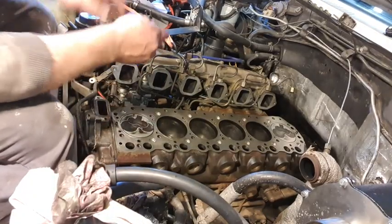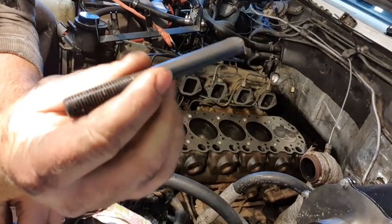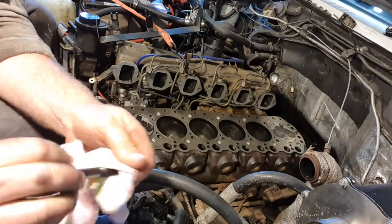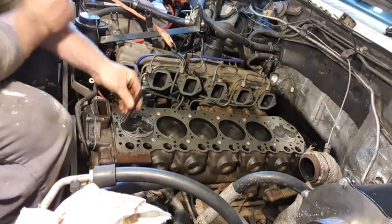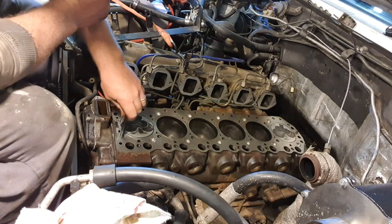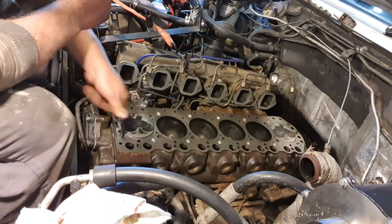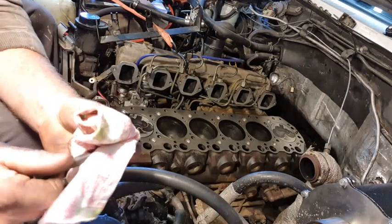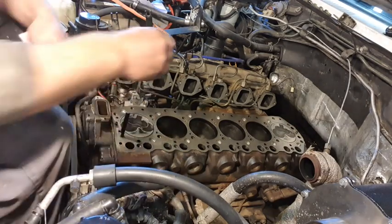What I was going to do — I've cut these old head bolts here, I've cut the top off them, and I'm just going to fit those into a few of the head bolt holes just to help guide everything down as I'm lowering the head. Just to keep everything nice and true and make it so that I can undo them in the end. I'll just do them finger tight — obviously they're not doing anything apart from guiding the head down.